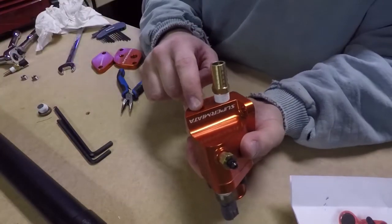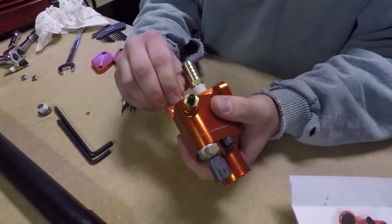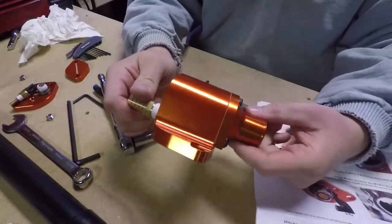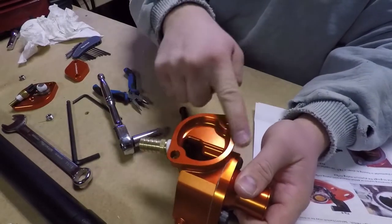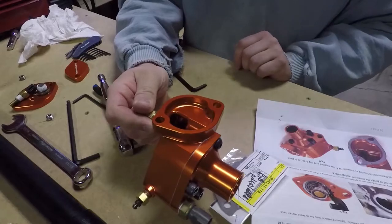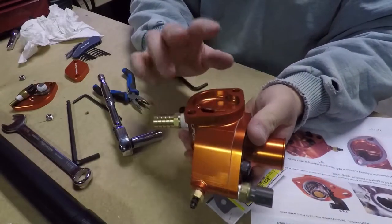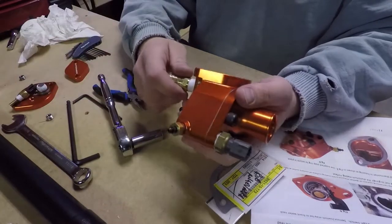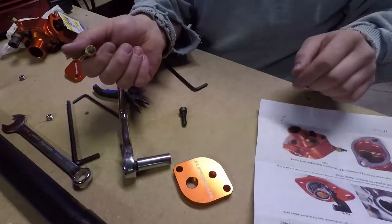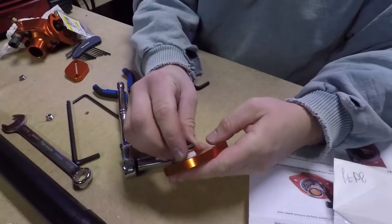Lastly will be a little plug for here because we have a 2001 NB — we don't have any other sensors to go into this at the back. So you'll thread a plug in there with some sealant. Once you have everything assembled, the next step will be to put some silicone, but we actually have gaskets for it. We're going to go ahead and install a gasket there, which might end up being a bit easier because with the silicone, trying to maneuver it into the back of the car might get tricky. So we're going to use a factory gasket even though the instructions just call for silicone. We'll put that on with a gasket, and then the next thing will be the front plate — we're also going to put that one on with a gasket, and install the plug with some thread tape.